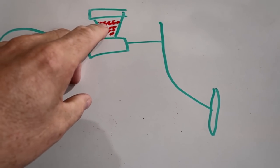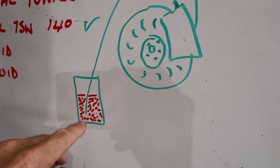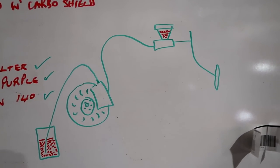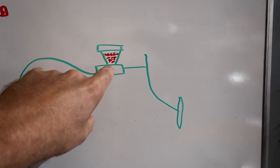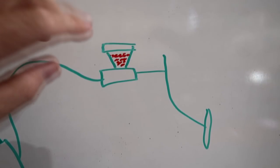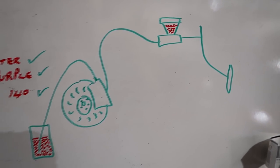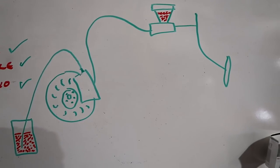Typically on a brake, do four or five pumps, add some fluid. Four or five pumps, add some fluid. Don't let this overfill. When you do drain this, don't let it get below the straw because it can suck air back into the system. Once you've flushed adequate fluid through, you'll see this start to turn all kinds of gross colors, then start to get more and more clear as the dirt and debris gets pushed through. What we do first — we suck as much of this out as we can, refill it with some clear fluid. Once you've flushed an adequate amount and it looks like everything is clean, now you're going to actually bleed it.